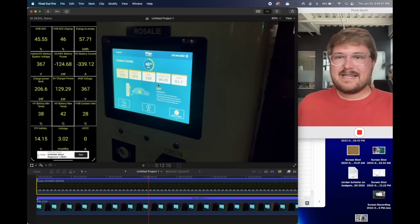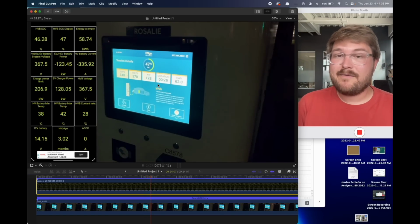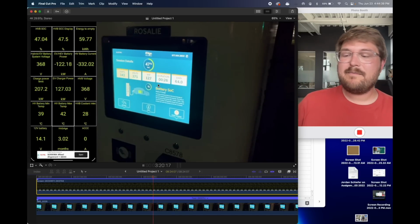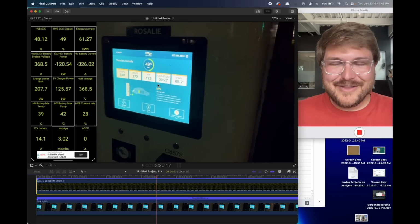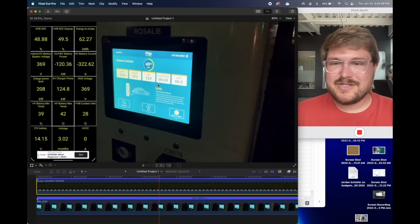So some of it has to be modeled, predicting what temperature a component might be, for example, a specific area of the battery pack or a connection point. And because you can't put sensors everywhere, you kind of have to think, okay, well, it could probably handle 10 minutes no matter the conditions at max power, and then we're going to have to derate. And that's what I imagine is going on here.